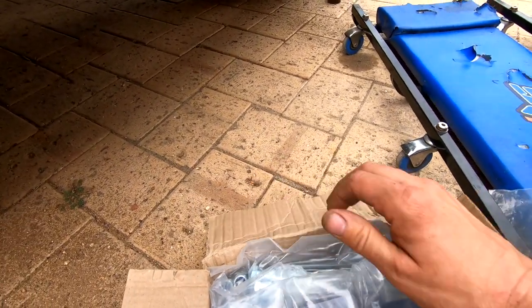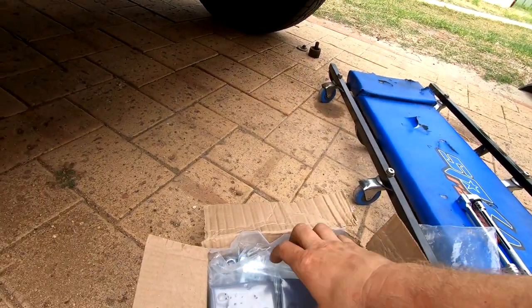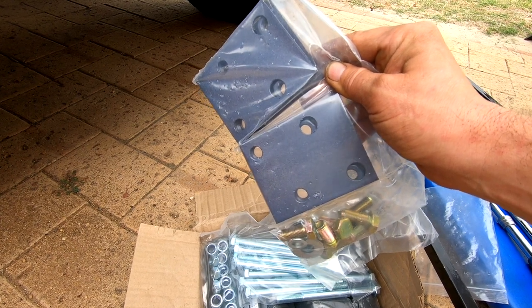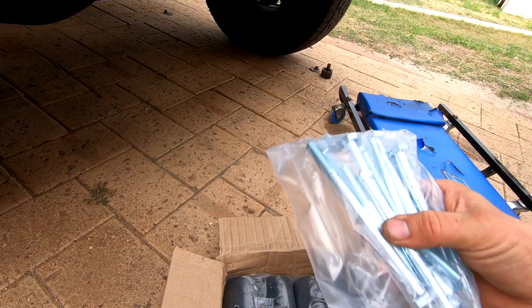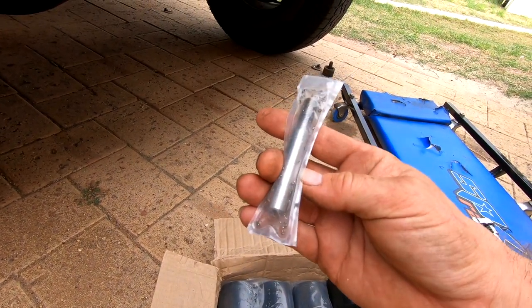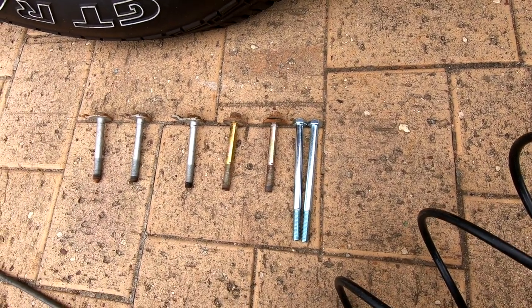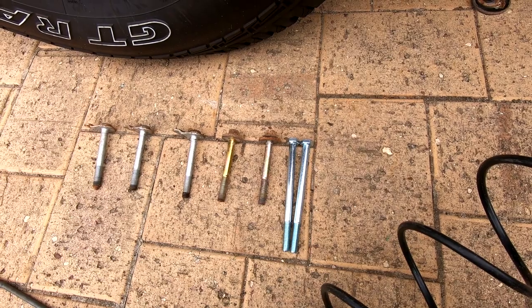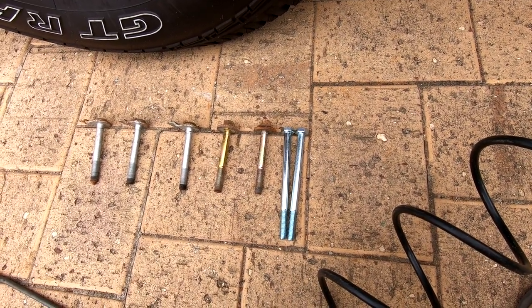All the way from the UK — just like me. We've got bumper relocation plates and bolts. I was wrong about the front — you get the front bumper relocators automatically; it's the gear lever and transfer lever bits that are optional. So I've got some spare set bolts, transfer lever extender, and 12 body blocks. You can see the difference in bolt length — obviously two inches longer. I'll sit all these in the holes where I took the original ones from, and as I go around putting blocks in I'll pull them out one at a time — that way we won't get any shift of the body.